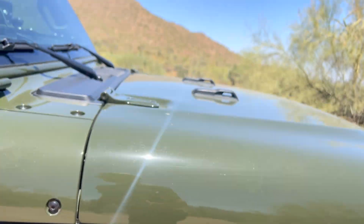See the hydro bump there on the passenger front is probably halfway compressed, so there's not a whole lot more bump stop give, and it's about perfect on that flare. It's just kissing the outer edge of that flare again with the wheel turned a good bit as well. So pretty happy with that. Plenty of clearance on the back pinch seam on the firewall side, which is great. Let's look at some of the other corners here.